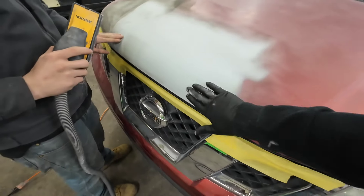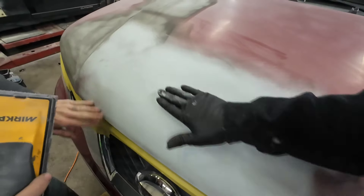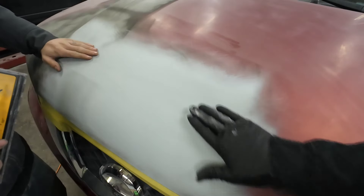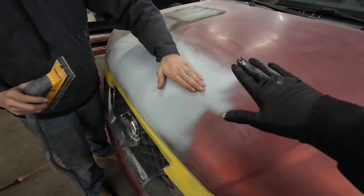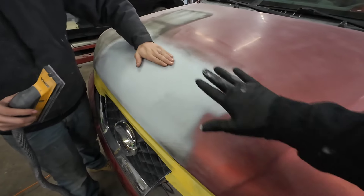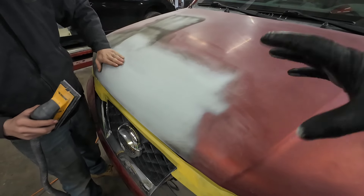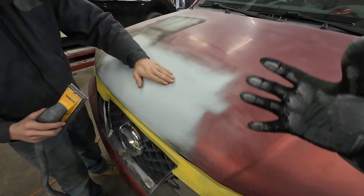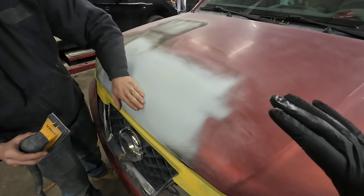We're also teaching Darius how to get a feel for it. This all feels really good. When you feel over it, use the flat part of your hand and move quickly across the panel. It takes a little bit of time to get used to, but once you get a feel for it you can feel any imperfections in a panel.